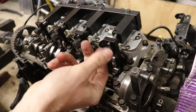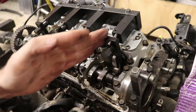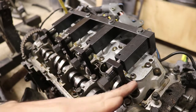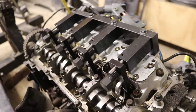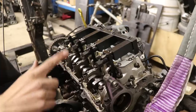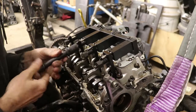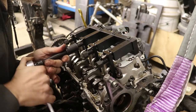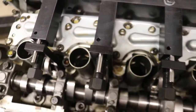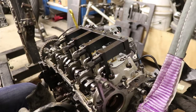Now you can see how this works. These screws actually work backwards — you turn them counterclockwise to tighten down on the valve, and clockwise to loosen. Tighten them down until all valves are fully seated on the back. You can see one valve is already seated because of the engine's rotation, and here's one that's not yet seated where you can still see the spring. The bolts are 17mm head. When a valve is fully seated, these two pieces come together completely.